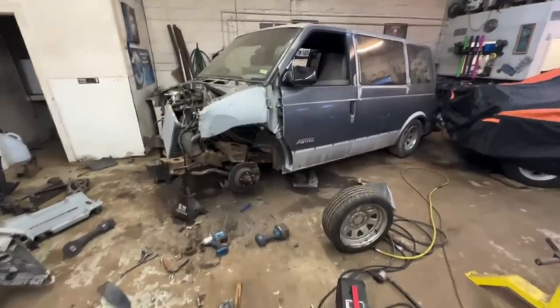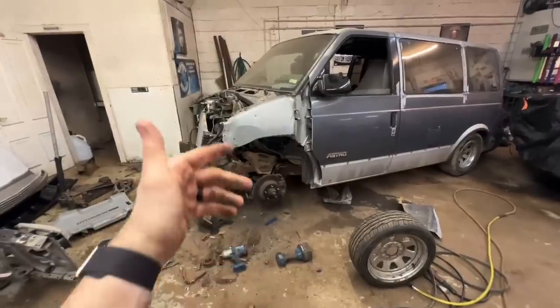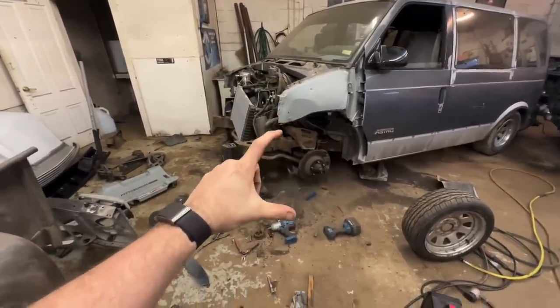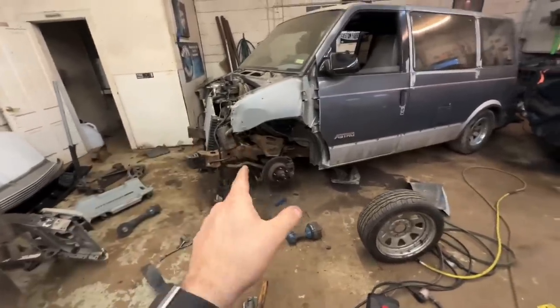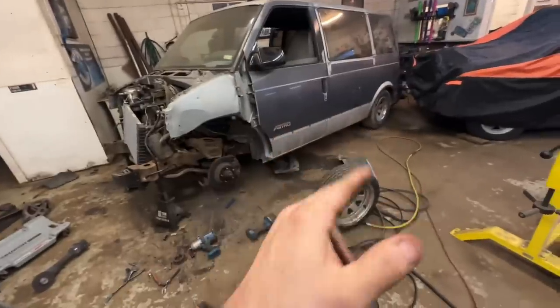All right, so I put the other wheels on that we had. They went down. It's actually hitting on the airbag mount because somebody put like a 4-inch bolt in there, and you don't need that. You just need a normal bolt. So I cut that down. I think I'm going to hit the frame next, but the good news is we were not running those tires.